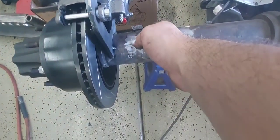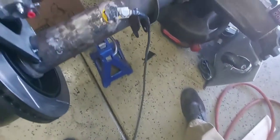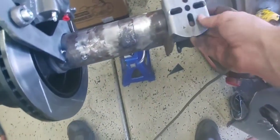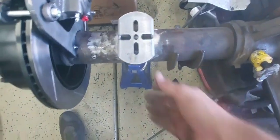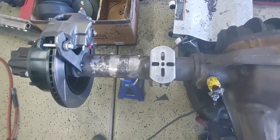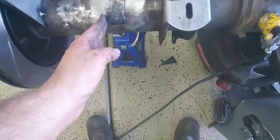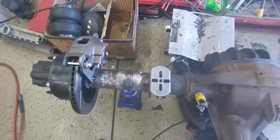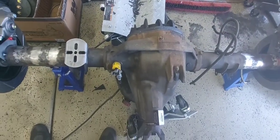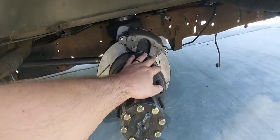It may not seem like a lot but that gives me two inches — I can do my four-link bracket and my airbag bracket here, probably on the inboard side of the frame right above the shock mount, with the four-link sitting on the outside of the frame. I'm also doing a truss so everything's going to be tight in there and welded up. The axle is back in, these brakes are all done — just tacked in for now.